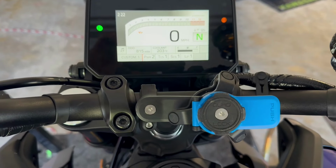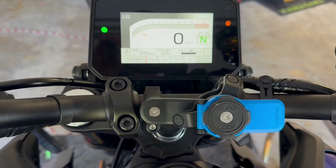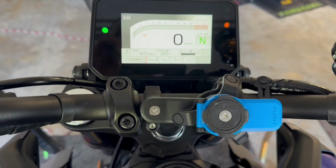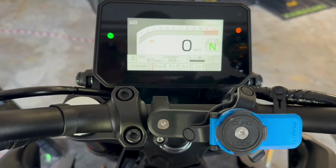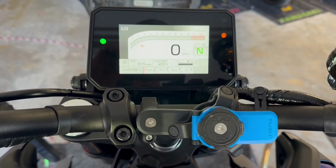the O2 sensor is normally not doing anything at full throttle anyway on almost every bike I've ever tested, bar a couple. On the MT09, I don't know if it's actually turned off, but it's not affecting the fueling when we're doing dyno runs. But when I'm riding down the road, it really did.